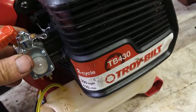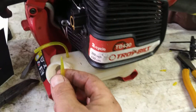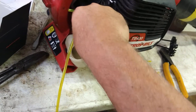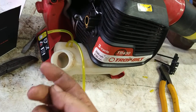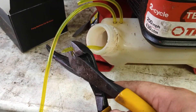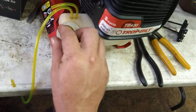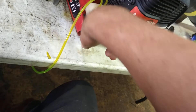Get the new carb up against it so you can get a guesstimate of where the fuel line goes, then cut it to length and cut it to a point again. Put it in this hole and this time go all the way through and pull it out the tank. Cut the tip off, then take the fuel filter and stab it on. Push the filter down to the bottom — make sure it gets down in the tank and sits in the middle on the bottom.